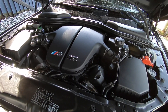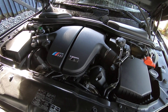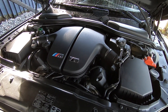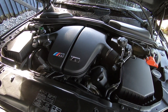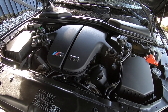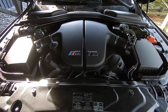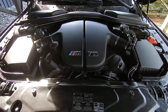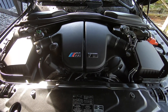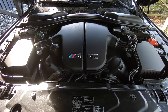If you're noticing a lot of noise from your Vanos system, it's unlikely that changing out the solenoids will help reduce the typical noise issues — especially with earlier cars. They've got the noisy Vanos gears, so a new set of solenoids won't resolve that. The Vanos system also uses a pressure accumulator, and although it has the potential to go bad, I've never heard of one failing. Even if it does fail, replacement is relatively cheap, but it's super, super rare.